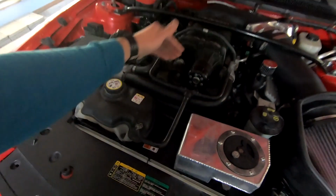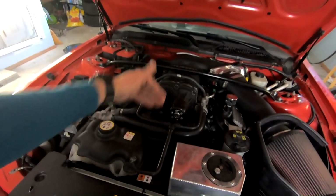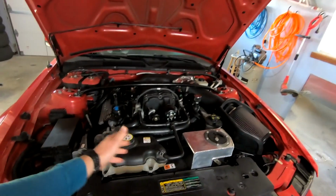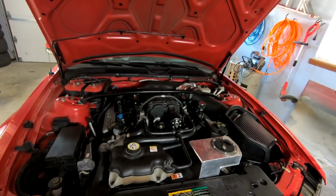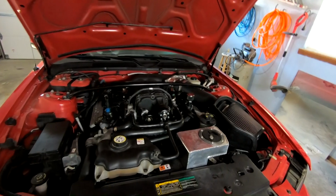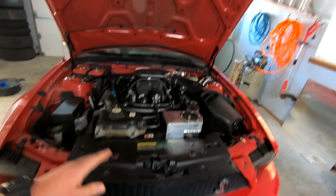If you look down here, well, you can't see it. I can see it. It's trying to pull it. You can tell it's still being pulled back just a little bit. So the 2.4 millimeter hub spacer should do the trick. Didn't think that was a problem, being their blower, their pulley, but they make the spacer, so whatever. It's a thing, so I got it. It's like 10 bucks. So that was that.